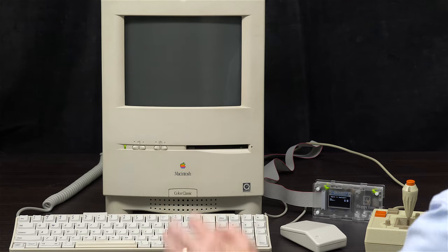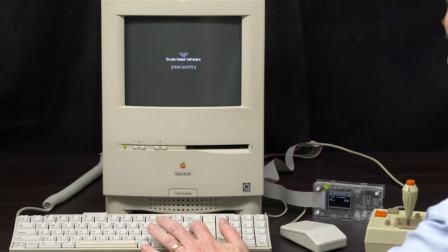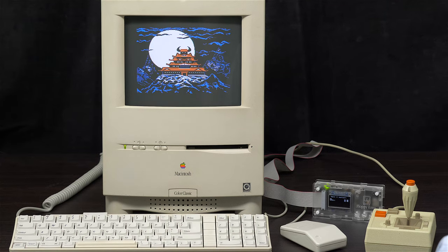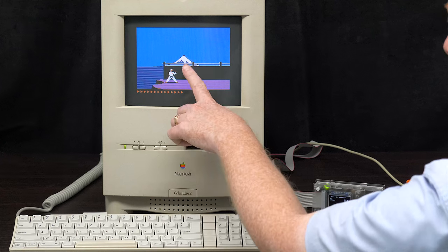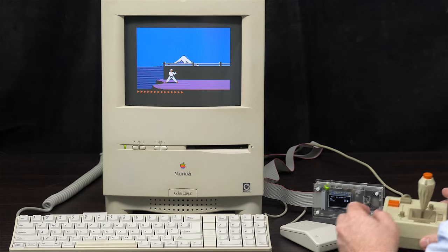We download the 32 megabyte HDV hard drive file, copy it to the SD card root, and rename it — I'll call it smart0-TotalReplay5B2 so it's easy to see on the Floppy EMU display. Then back to the Color Classic with the card in, it's showing Total Replay. Loading 2E Startup with Option key held down to confirm settings, I set it to Fast. Then clicking Continue and typing P-R for Prince of Persia, it says 'press return to play.' The LED flashes as it accesses the drive.